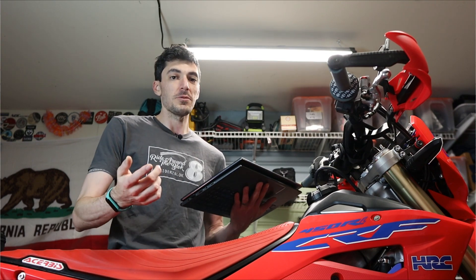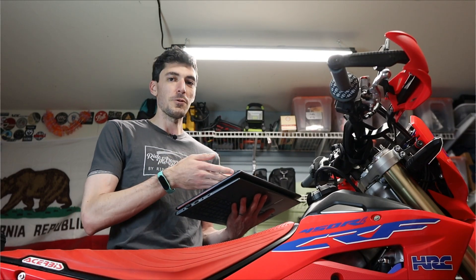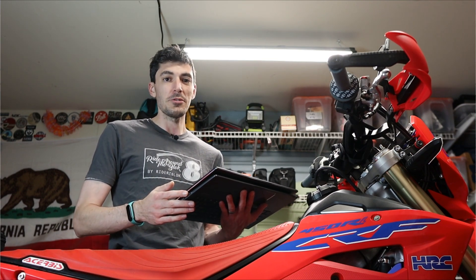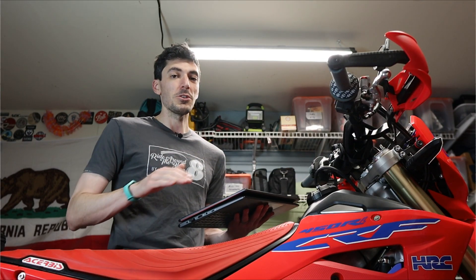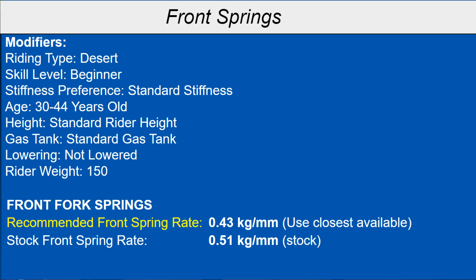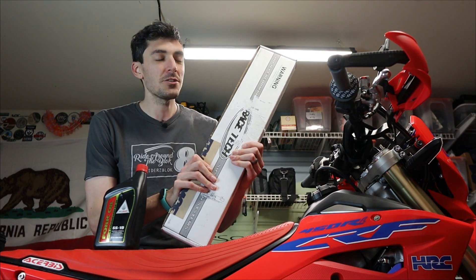It's the front that gives me more issue. The website doesn't provide as much information for the front — just the recommended oil level and a front spring preload of 5 mm. But front fork spring preload isn't adjustable externally; you have to pull the forks out and disassemble them to check it. Looking at the Racetech Suspension Bible settings, my average front sag is 38 mm while the recommended range is 60 to 75 mm — almost half what it should be. That means the front is too stiff, indicating I need a softer spring rate. The Racetech website recommended 0.43 kg/mm versus the stock 0.51 kg/mm — so that's exactly what I bought. In the next episode, we'll be installing these, checking the preload, and seeing what difference it makes.